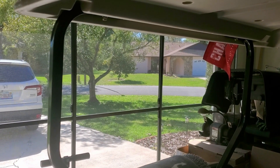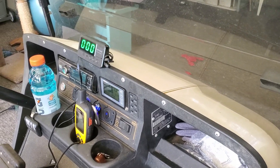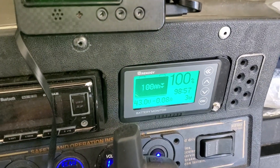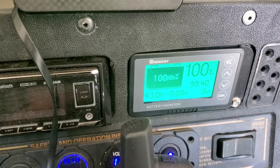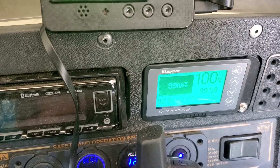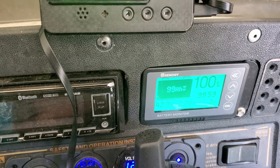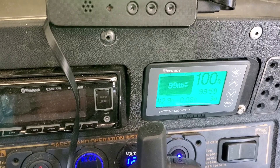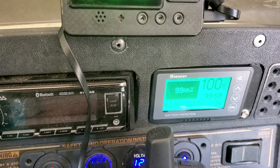It's a nice day, probably going to take about three to four hours. We're going to hit a nominal speed of 15 miles an hour. It's 3 o'clock on the dot — charger disconnected and starting voltage is 43 volts. We'll take it down to 10 percent. The lithium pack is very consistent through 90 percent, but that last 10 percent the voltage really nosedives. When you floor it, loads can momentarily go well above 100 amps, causing voltage to drop and kill the pack, so you have to be careful at the last 10 percent.